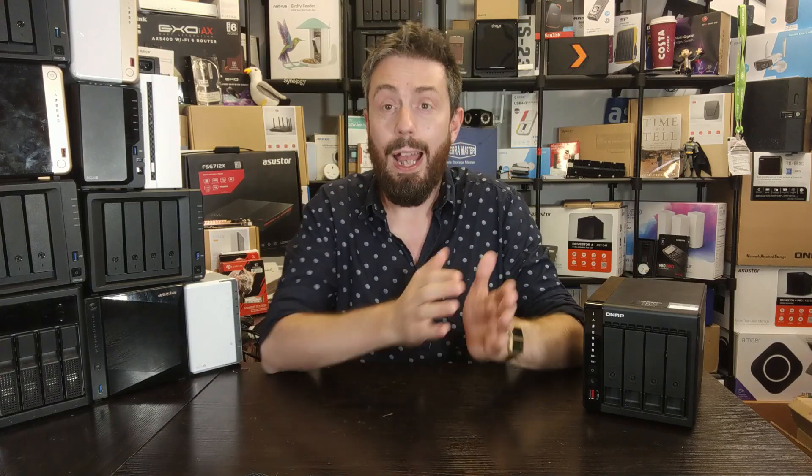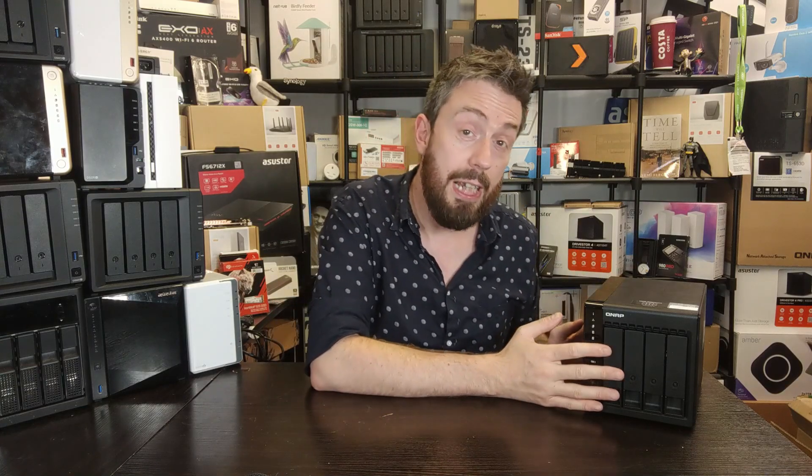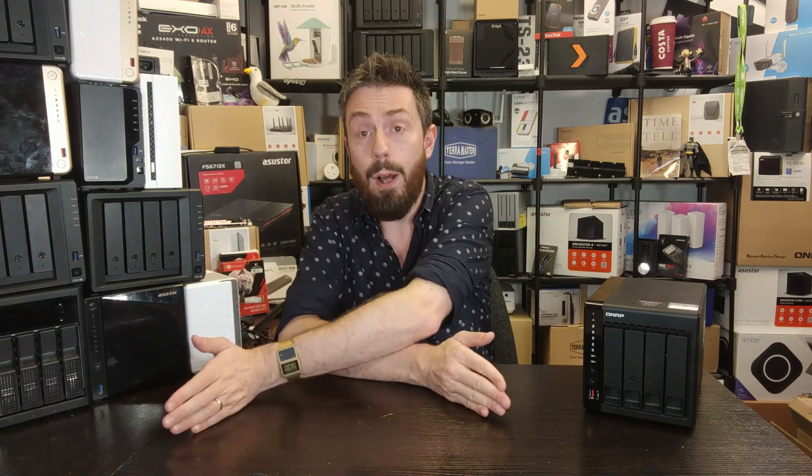The TS564 is powered by a Celeron processor with three hard drive bays and two SATA bays — the same physical size as a two-bay but delivering a five-bay storage system, with later revisions even including M.2 slots, making it a triple-tier desktop system. So why are some releases China only? One major reason is that refresh cycles for existing systems happen intermittently — normally a range like the TS-453E or TS-464 has a run of around two to three years, after which it's refreshed. Manufacturers like Intel also have their own refresh cycles where they phase in a new CPU, forcing vendors to adopt the newer versions.